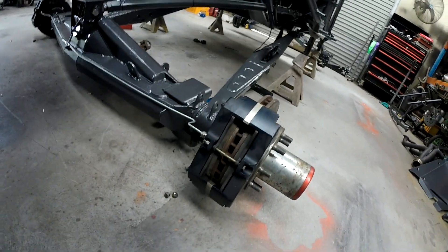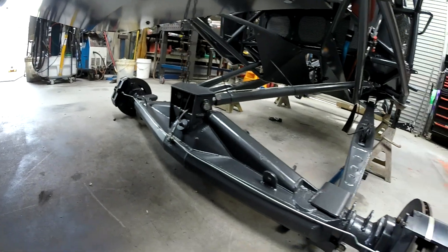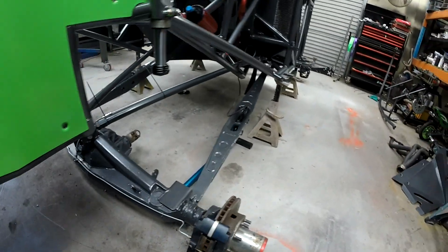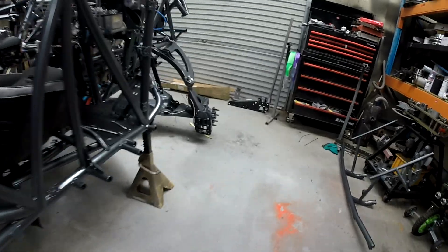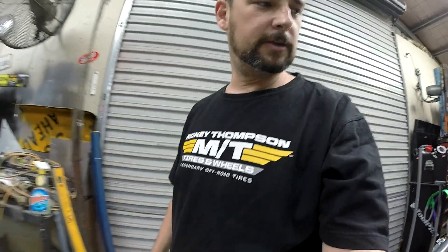It runs back down into hard line. We've put all the hard lines on the back sides of things — most of the time we're hopefully going to be traveling forward, so the idea was to put the brake lines on the back side of everything. That gives them a bit of mechanical protection so we don't unnecessarily rip any brake lines off.